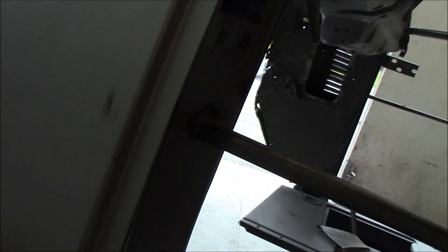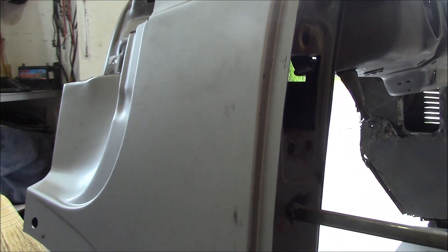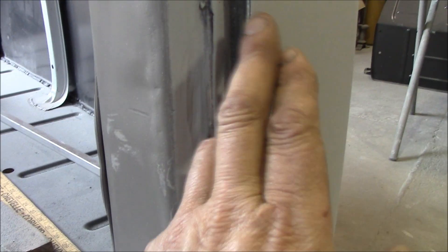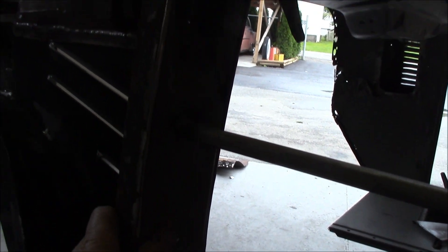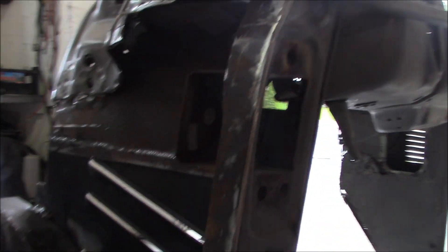Now when doing this, you have to make sure when this piece goes on — you have to make sure that from this lip on this opening to this lip — you want to take measurements right across this whole opening to make sure you're not tightening it up, because don't forget the door's got to fit back in there. Nothing should have moved because I've got it braced anyway, but it doesn't hurt — take lots of measurements to make sure you're doing it right.